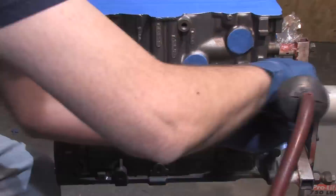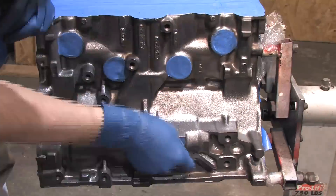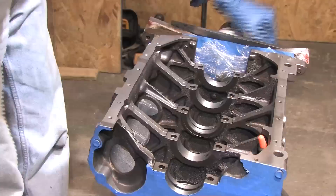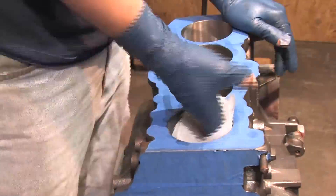Your best friend for removing surface rust is a wire cup brush. It's effortless, really. It's important to remove it because the more there is, the faster it rusts, and leaving it alone can lead to pitting. Powder coating isn't the only treatment it will receive — my cylinder head was coated with Glyptol, and I intend to repeat that same treatment inside the block.